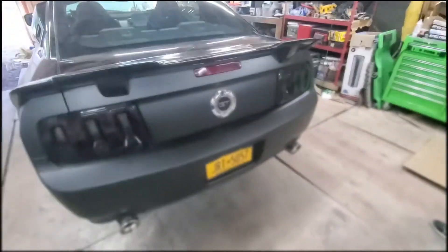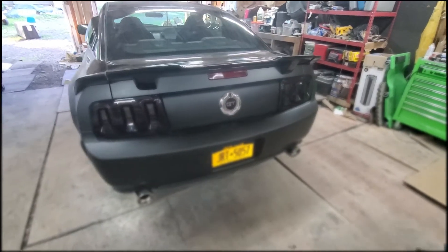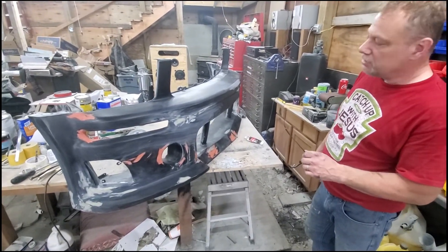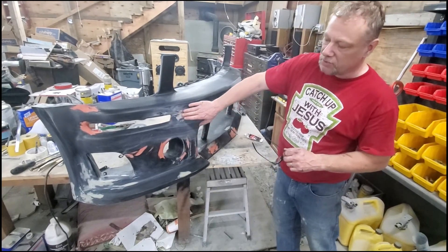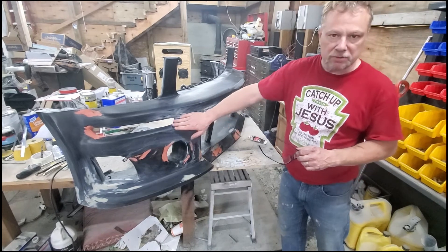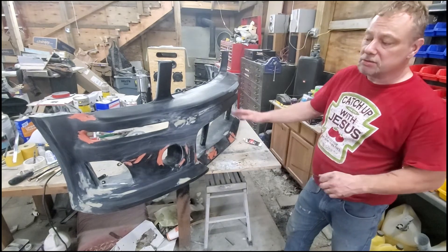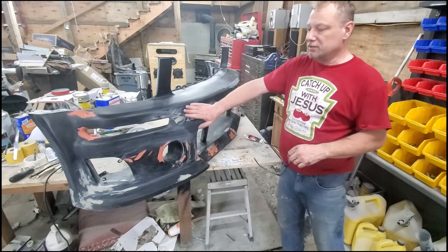Here's what the back looks like — matte finish with the gloss. On the bumper there are a couple of spots that were bugging me. I used this stuff here, but I don't like it — it takes forever to harden, and if it's not hard it tears when you try to wet sand it. I let it sit for about an hour outside at 85 to 90 degrees and it was still tearing when I went to wet sand it.